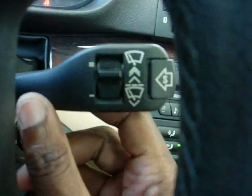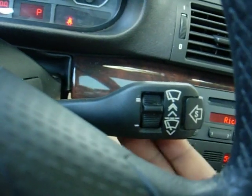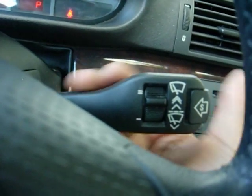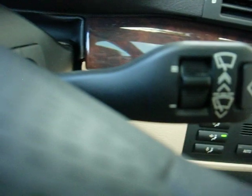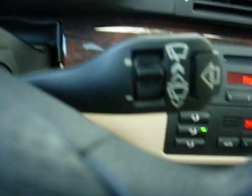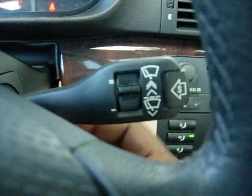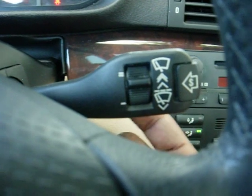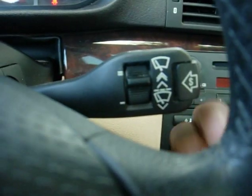Make sure your car has pin 10 wired for the stalk. My car came with it, so I just plugged the extra pin wire from the car into the stalk. If you have headlamp washers, there may be an extra pin — I think it's pin 5 or pin 6 — that you need to connect. But if your car came with headlamp washers, the S-function button will make those work as well.